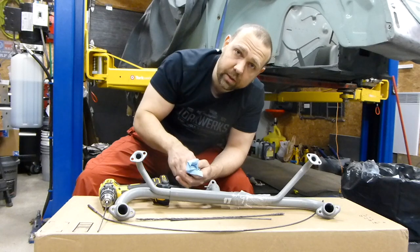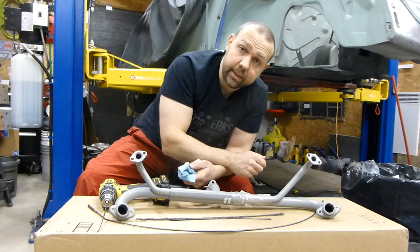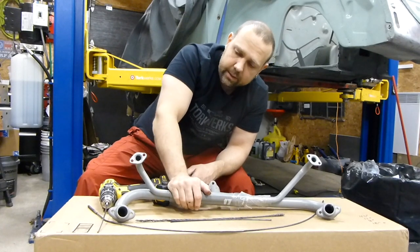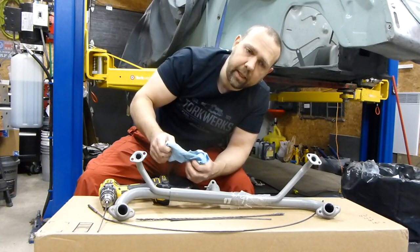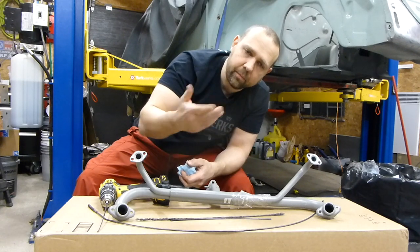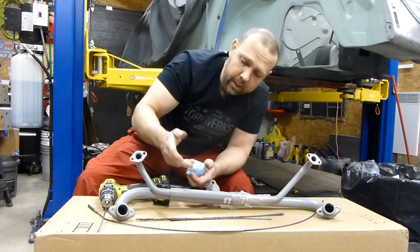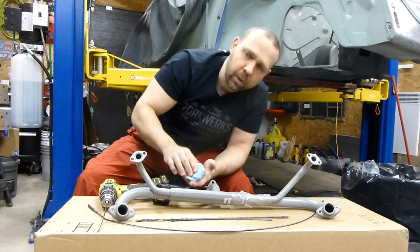Will it be 100% clear? You can't really see inside, but you'll have an idea based on the airflow from your compressed air. If you take the intake off the car, you can do the same process, and the only additional step I would do is get some sort of carbon engine decarbonizing product. They have a lot of chemicals out there to help break up carbon in a motor — you could run some in here, let it sit overnight, and it may soften up the carbon and allow you to chisel it out with these cables much easier.